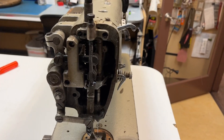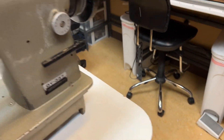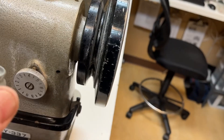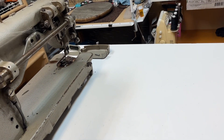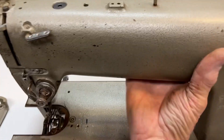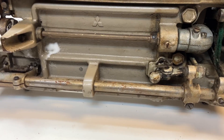This Free-All has a pretty good spray to it — it actually smells good. We're going to go down in there. I took all the little plates and covers off. I'm going to go in between the hand wheel here, and we are going to tip it onto its backside so we can get the underside again. I can see all the little moving parts and I'm going to give those a shot.